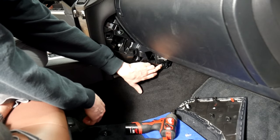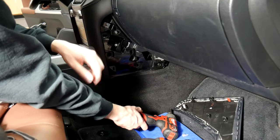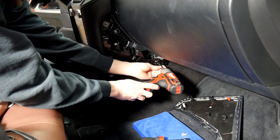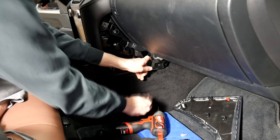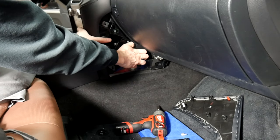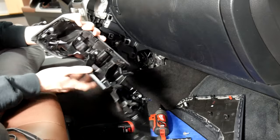On this panel, you also need to get this clip right down here. There's a little insert in the middle of it, so you just need something slim — I'm using the tip of my Phillips head. If you just press in on that, you'll hear it click and it'll fall right out. Then this panel just pops right off, held in by a few diagonal clips.